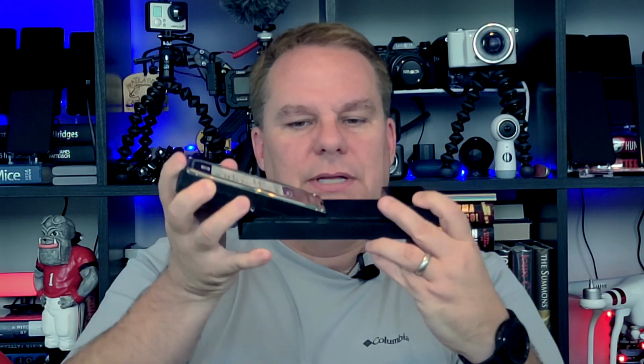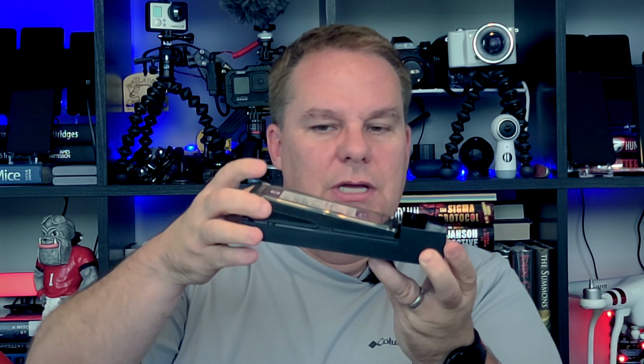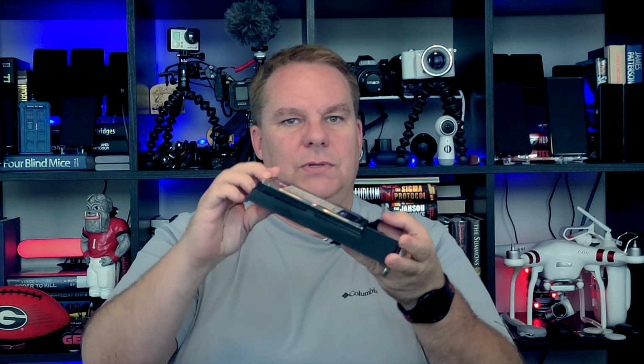Then what you're gonna do is locate the plug on the hard drive. Simple enough, if you look at the label and read it like this, generally the plugs are on the bottom. Boom, there they are. Now you see in the box here, all the controls are up here hidden inside this, and the plug is right there. You'll take this, place it at a slight angle, sliding it in. Once you get to a little bit of friction, drop it down a little bit and give her a shove in. Now she's locked in, okay?